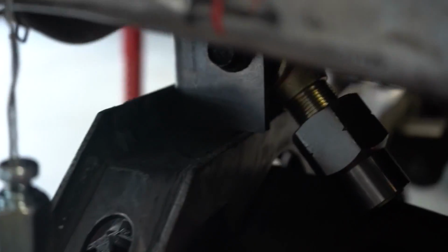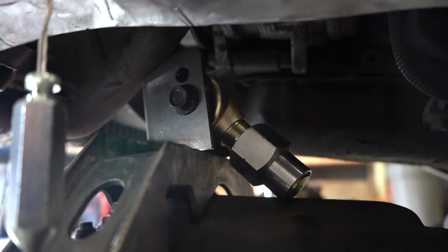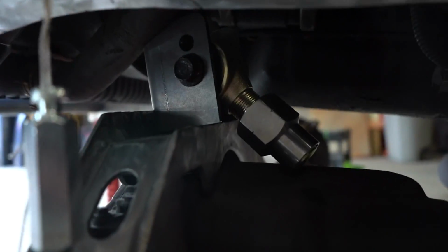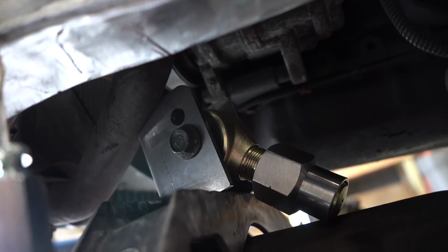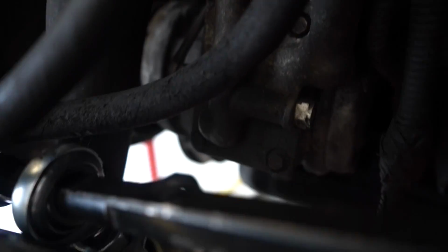And then up in here is the upper control arm bracket. Again, it's an adjustable one. I do have about 9 to 10 inches of separation. I think this lower bolt gives me 9 inches of separation at the axle, which is pretty freaking good. So I'm pretty happy with that. I do think I might end up trimming that, because the issue that I'm running into is that this is the AC compressor right here, and the axle right now is about at ride height.